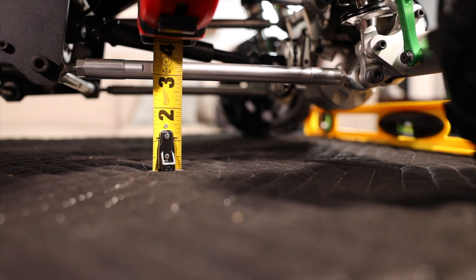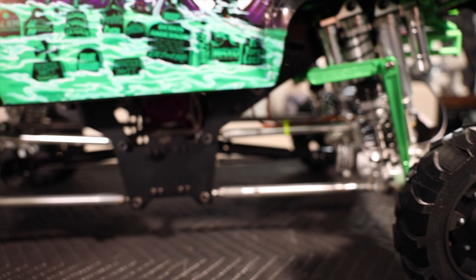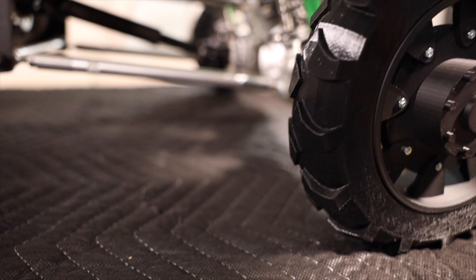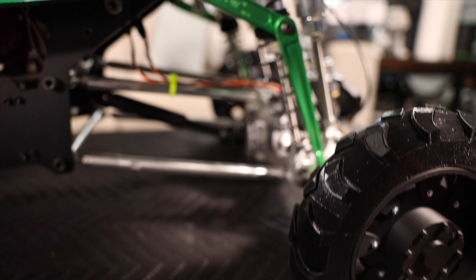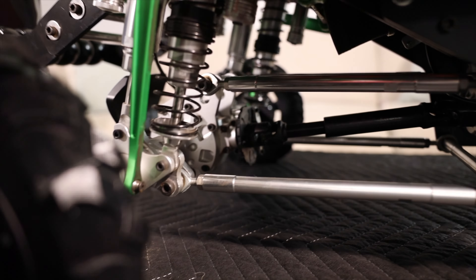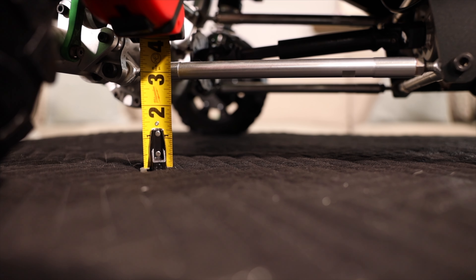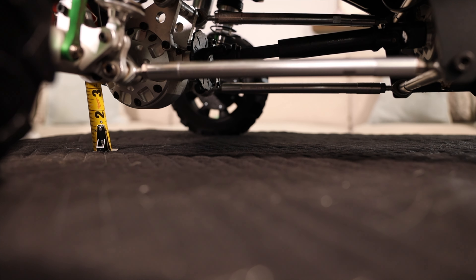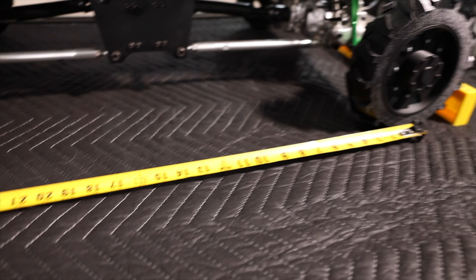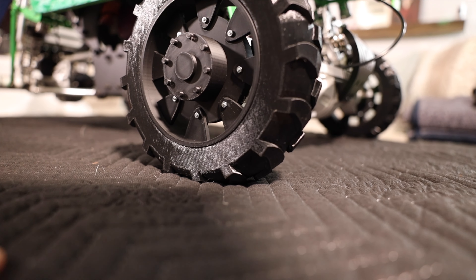You can see we're getting about three inches of clearance — just shy of three over there, but about three inches all around. This is with my setup; my arms are pretty much level and the shocks are a little more than 50% compressed. The rear shocks sit similarly. With the extended arms, I'm at 29 inches center to center, 21 inches between the wheels, and 24 inches wide in the front.